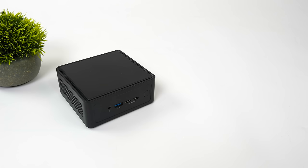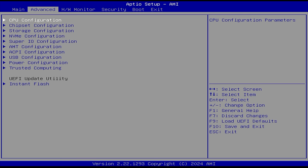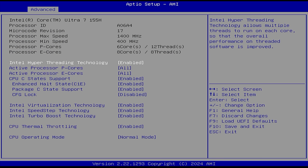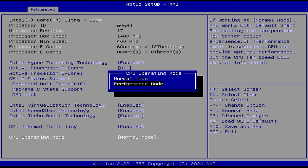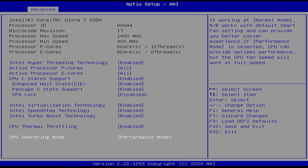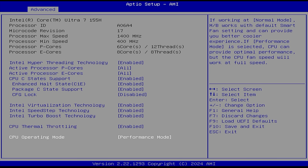I'm going to be running Windows 11 Pro on this machine. Now, with these ASRock mini PCs, if you want the best performance out of them, we need to get into the BIOS. While it's booting up, press Delete on your keyboard, and it'll bring us right here. Go to Advanced, CPU Configuration, and CPU Operating Mode — we need to set this from Normal to Performance Mode. This will run it up to around 54 watts; in Normal mode, around 35. There are some other settings in here like disabling some of the E-cores, P-cores, and even those low-power cores, but we don't have a TDP adjustment beyond that Normal or Performance mode toggle.